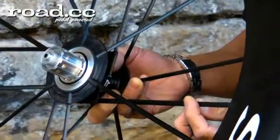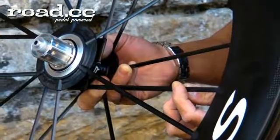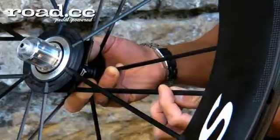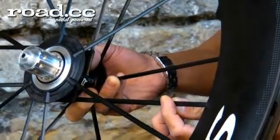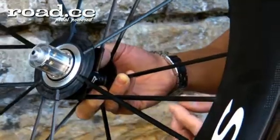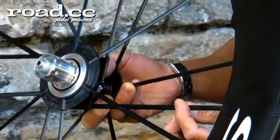The spoke profile is designated as an NACA0033 profile. This means that the width of the spoke is 33% of the depth. This is a recognized low drag symmetrical airfoil.